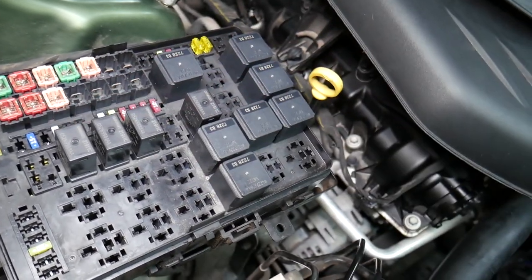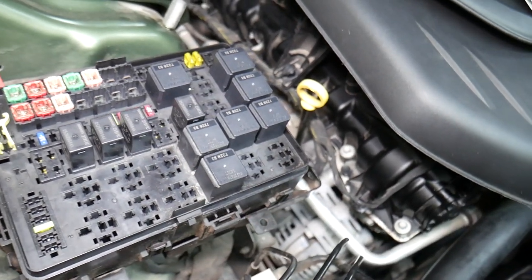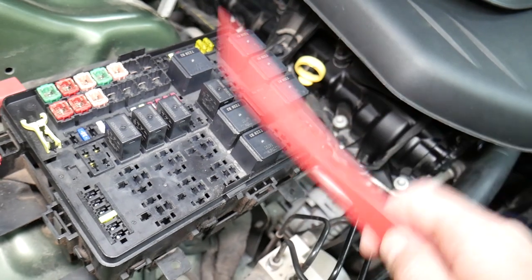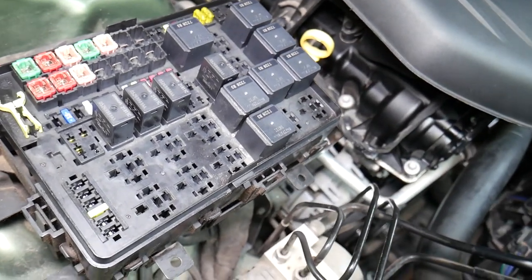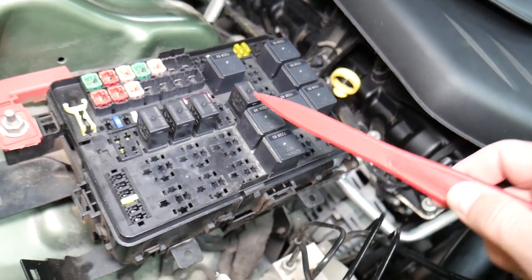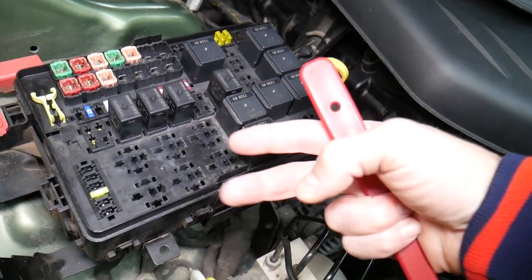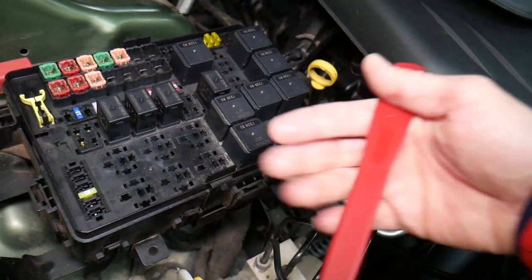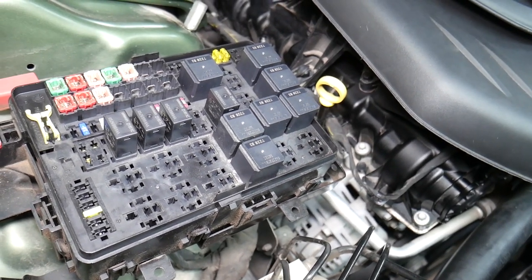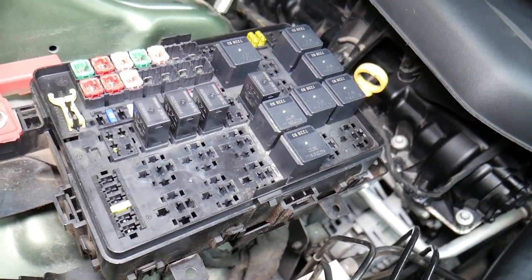For some certain fuses, it's important to disconnect the car battery when removing them, otherwise you can burn the electronics. For instance, when working on airbag fuses or anything like that, you need to wait at least one hour after disconnecting the car battery — and if you're not qualified and certified to work on an airbag system, I will never recommend doing that. Also, when disconnecting the car battery, it's important to know which battery terminal you disconnect and reconnect first. If you do it the wrong way, you can burn electronics modules — we've done it before, burning a traction control module on a BMW that cost two thousand dollars. We'll put a link in the description below on which battery terminal to disconnect first.